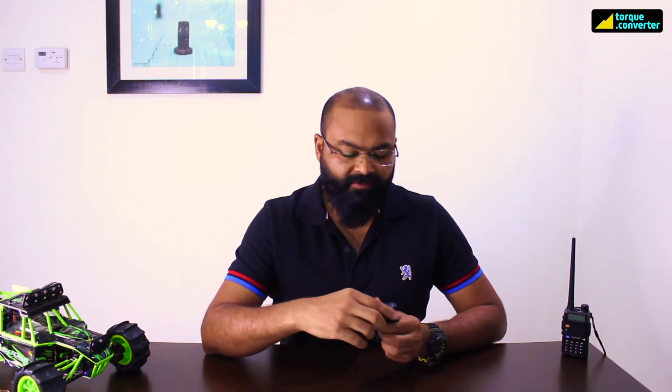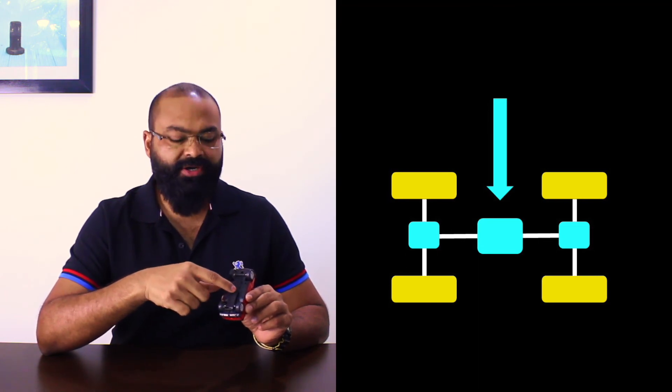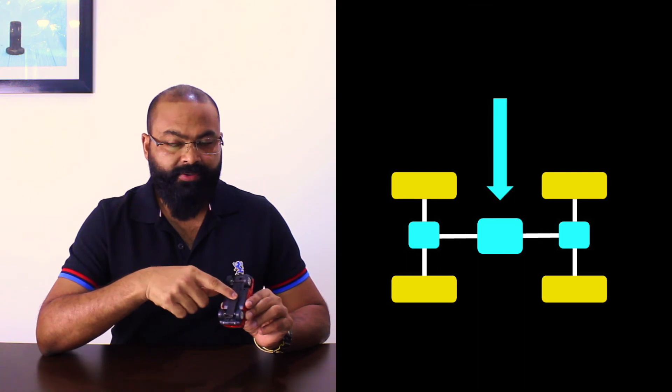Primarily there are three types of differential lock: front differential lock, rear differential lock, and central diff lock. Front diff lock locks the front two wheels from the center; rear diff lock locks the rear two wheels from the center. Central diff lock is commonly found in all-wheel drive vehicles, where the front and rear wheels are connected to a central transfer case through a shaft. When you engage central diff lock, it locks at the center and transfers equal power to front and rear wheels. In all-wheel drives, the normal power ratio is 30% front and 70% rear, or 40-60. Engaging central diff lock transfers power 50-50, giving much better traction and off-roading experience.